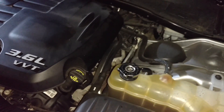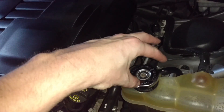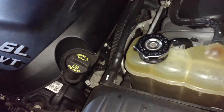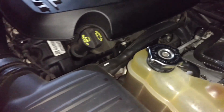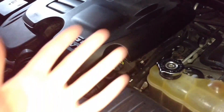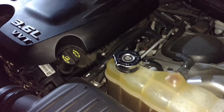Also, an extra note: if you want to go super boss style, they have a vacuum fitting that basically fits over the same way, but it has a connection on the side where compressed air goes through, which creates a vacuum. It will be so powerful that you'll see the hose shrink, and that way you'll know for sure that a hundred percent of the air is out. This method is good too, but there's probably still a bit of air trapped deep in the block. The vacuum method is a hundred percent and it's also a lot quicker.